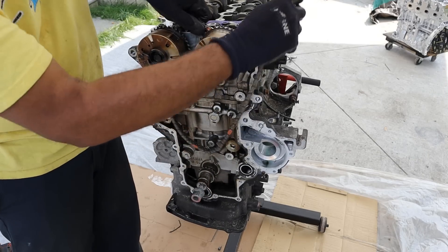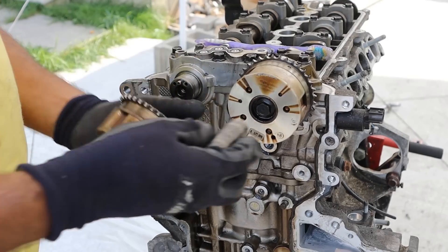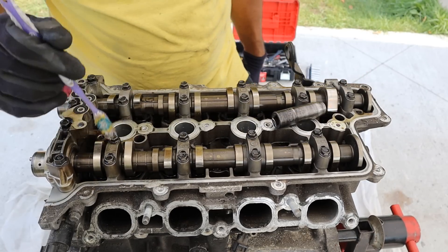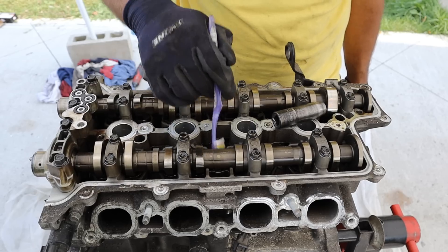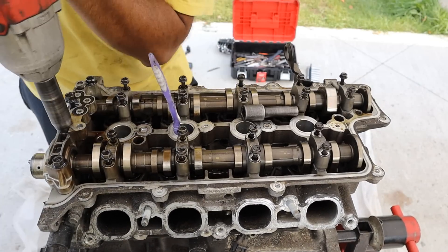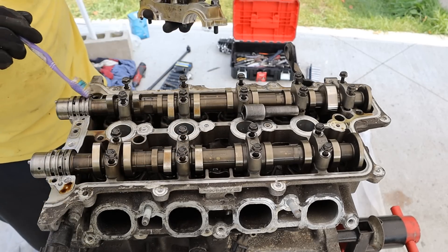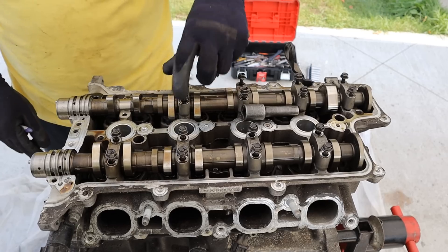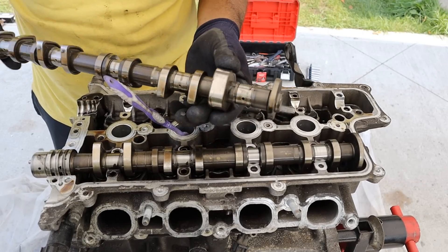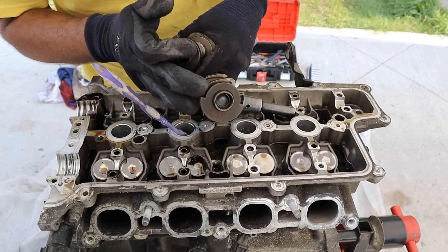Off the crank — it's like a bicycle chain, it's so tiny. I'll take off the cam gear. Next we're going to go up to the top of the head and remove the camshafts using 10 and 12 millimeter bolts, which need to come out in order to access the head bolts down below. You can see the ports for variable valve timing inside these tracks on the camshaft. I can pop off the exhaust camshaft — here you can see the lobe that powers the gasoline direct injection pump — and then remove the intake camshaft. Here you can see the lobe where the cam sensor picks up its reading.